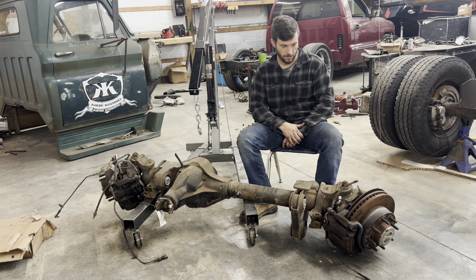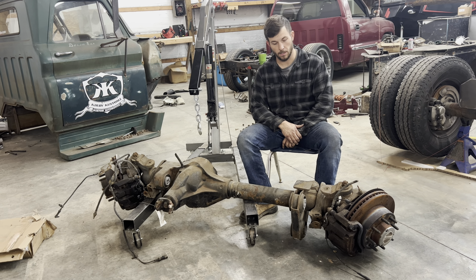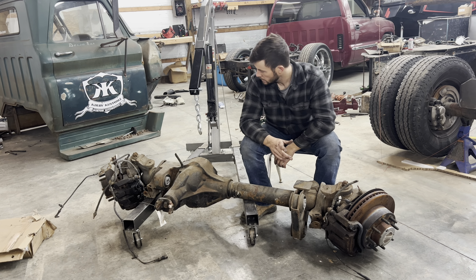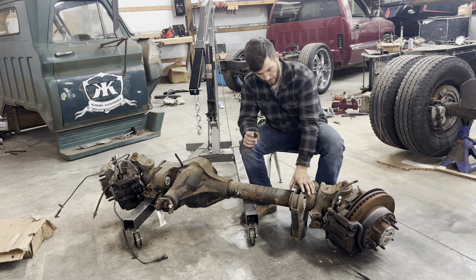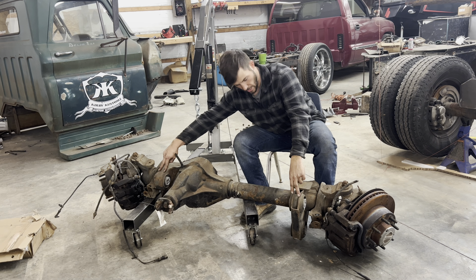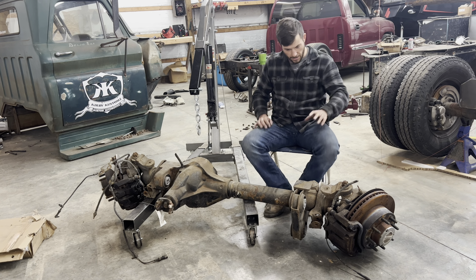I finally got this thing dragged up here. This is a 2009 — I believe it's an F-250 Super Duty four-wheel-drive front axle. It's a Dana 60 — Super 60, I believe — the coil-sprung axle with a driver's side drop. I'm going to be cutting basically all of the sway bar brackets, shock brackets, and bump stop on this side. I'm leaving the parallel four-link mounts — the factory ones on the axle — those are staying. I'll be building a truss after the brackets are removed.